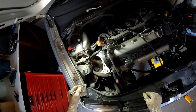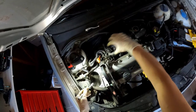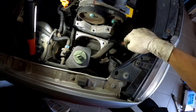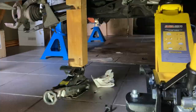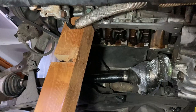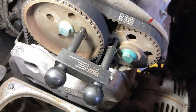This is the first segment from the inlet air box pipe — you have one here, one there, then the airbox. I'm puzzled now — how am I supposed to get to this bolt here? I don't have enough clearance. I found an alternative solution — with a piece of wood and the jack under the car, it's literally being held on the edge where the oil pan is. I think it's good. The good thing is now I have clearance to remove all the screws.